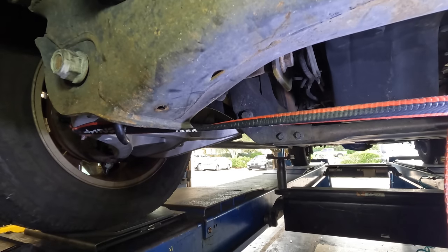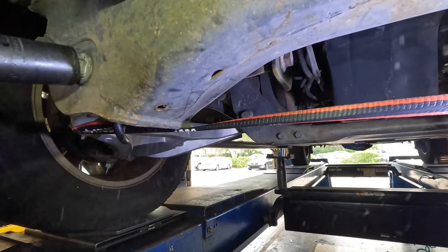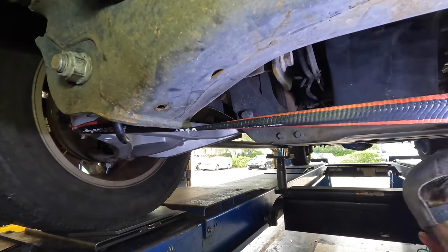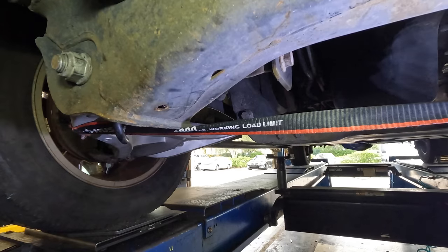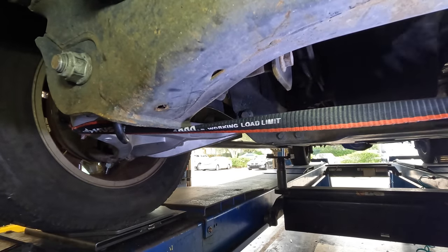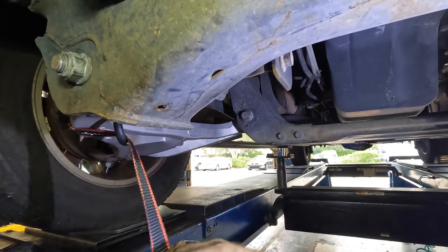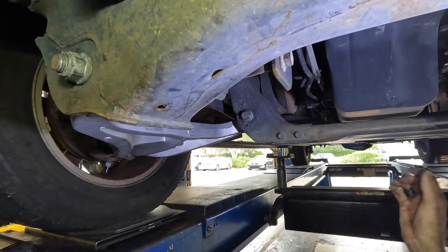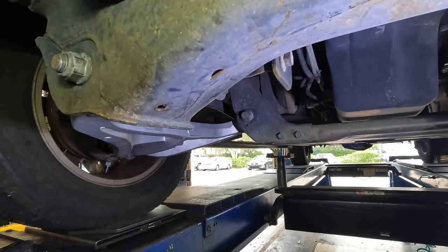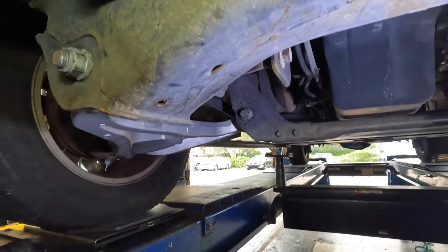Let's take this guy loose without noises. There's actually quite a bit of space I can play with. Let's pry bar this thing out a bit — and I'm looking over at my measurements. I got negative 0.7 degrees camber. A couple more clicks on this ratchet strap. That's all I got — lock it down. I achieved negative 0.6 degrees. Let up the tension on the strap and see where it settles — yeah, 0.6. We're going to go to the driver's side and let that one go negative slightly, because they have to match more than anything.